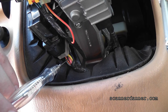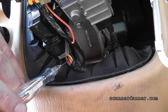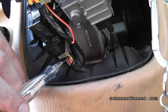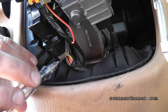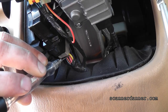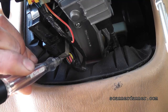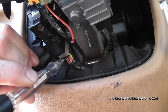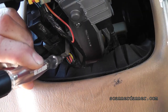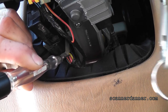Pink and black was good coming in. I better go check that diagram again. The yellow is the feed coming out. This is the crank circuit coming out — this won't be hot until cranking, and it's not. Am I wrong on my feed coming in? Let me go check that diagram. They've got nothing there cranking. Pink-black coming in, yellow coming out.